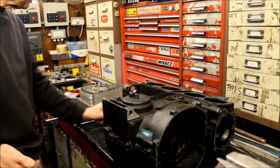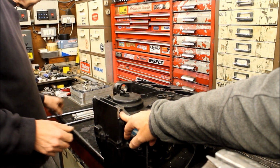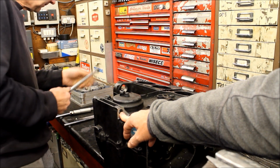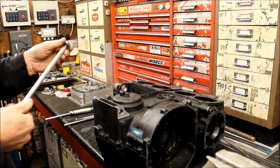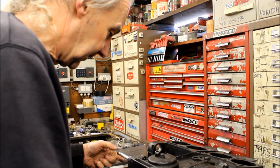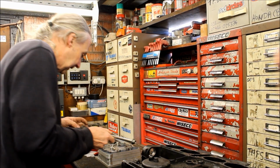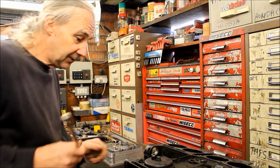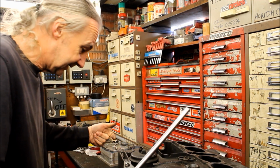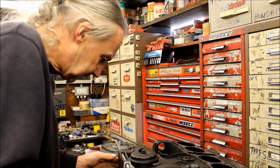So the original dimensions of that mounting rod, that pin, was what? Is it 12 mil? A 12 mil, and now it's not. It's now half an inch. Well, that's a 12 mil, and there's hardly anything come out. When you look at them, it's a bit loose, isn't it? Yeah, a bit rattly. Terrible. So you've widened that out to half inch, which is 12.7. It's hardly had anything out. The half inch went in, but I think they're more like tapered holes. Okay, so that's now a much firmer fit.